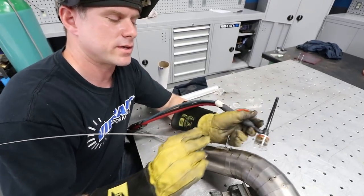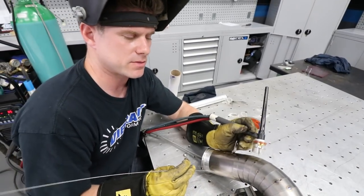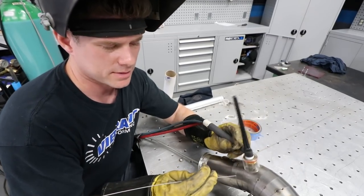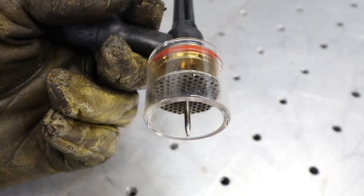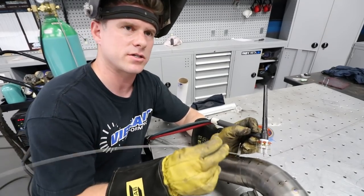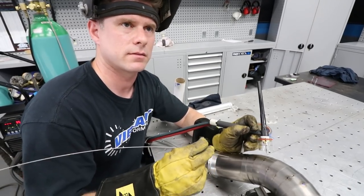I've got roughly about 2 inches welded on my first pie cut. Since I don't have a trailer — a trailer is a piece that keeps argon shield over more of the weld path after you weld, keeping the cooling weld covered in argon as you progress — I'm just using a big cup that gets lots of coverage and doing one-inch-at-a-time weld patterns to keep discoloration low. A good tip is to count your dabs, say 8 to 10, stop, let it cool a bit, then keep going.